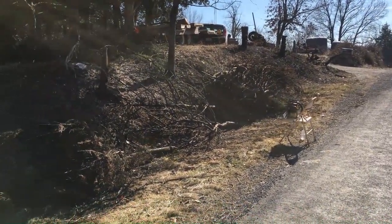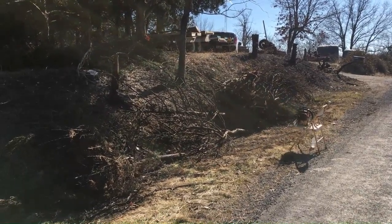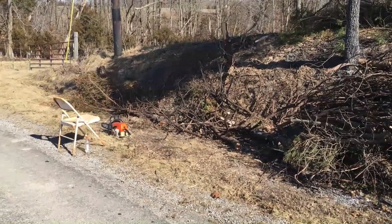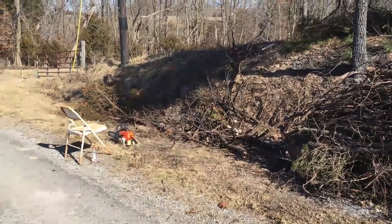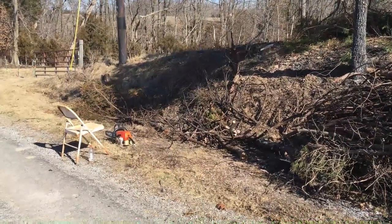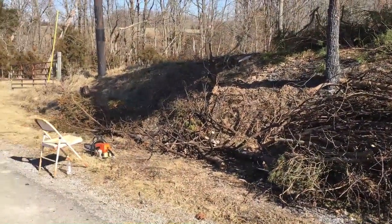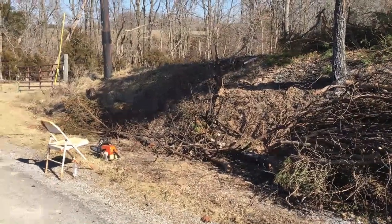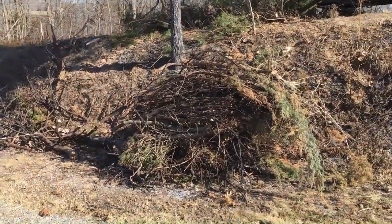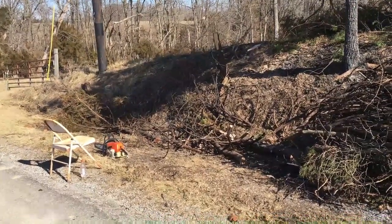Okay, yes, start cutting. It's not going to wait for me. Well, I got them cut up. Chainsaw still not starting the way it's supposed to. I get it started in the running position, but then I got to flip it up past the off switch to keep it going. Otherwise it dies after 15 seconds or so. It doesn't run very long before it shuts off.